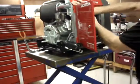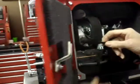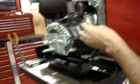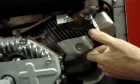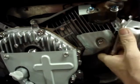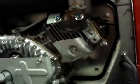Remove the valve cover. It's easier if you go ahead and remove the spark plug cap and just let it hang out this window. And then we'll pop the valve cover loose from the cylinder head. It has to be spun counterclockwise and pulled out. Now there is a gasket on this generator. It's stuck to the cylinder head, which is rather convenient.